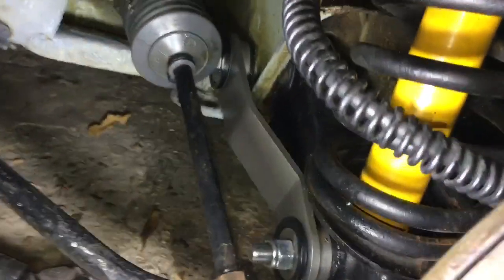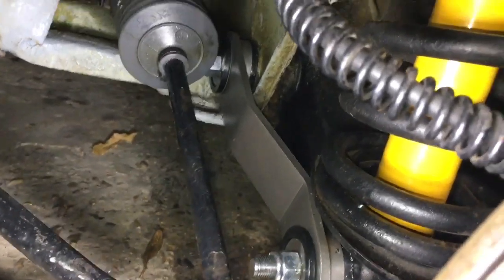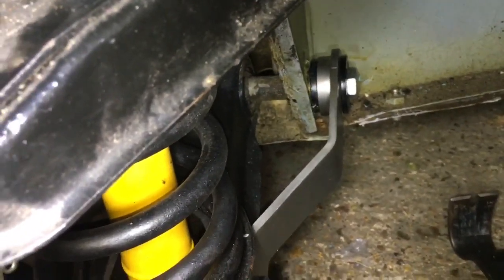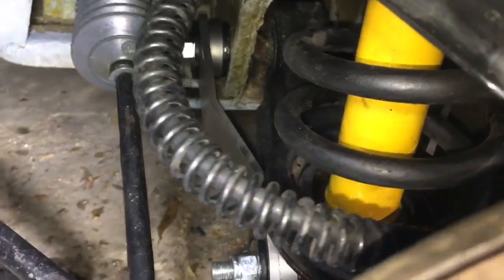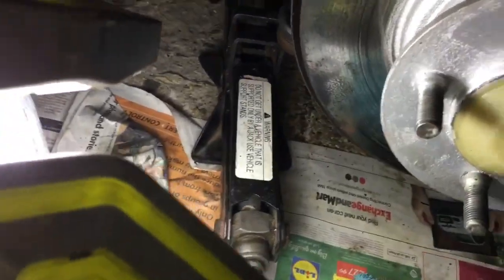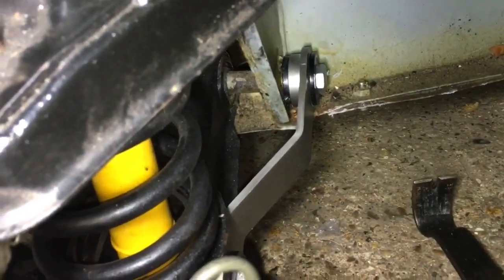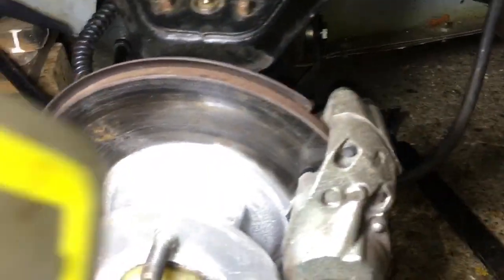The left-hand side is done. I've got the bolt heads coming through this way — not sure it makes a difference but that's how I've done it. Important note: there are no instructions with this kit, so be aware that the more angled piece goes pointing towards the back of the car and the less angled piece goes on the front. Don't fit it the wrong way around — it won't fit. Getting three of the parts on was fine; the fourth was a little more difficult, but all I had to do was use a small jack under the disc, jack it up a little to wiggle it into position. Used grease on the bolts and washers all in place — pretty easy overall.